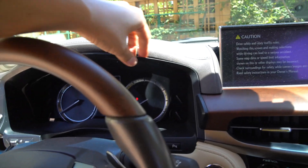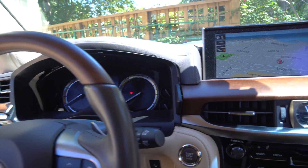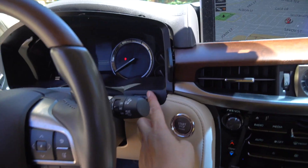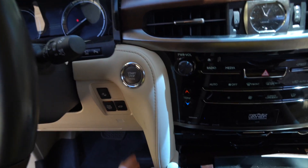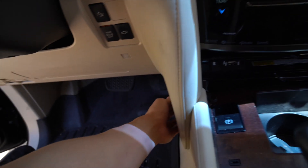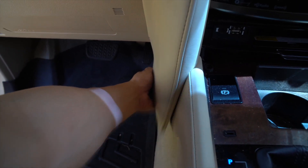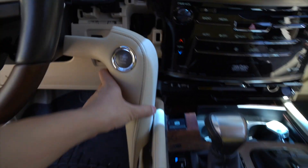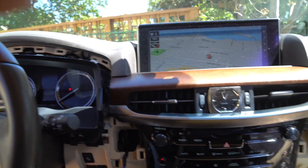I'm going to go ahead and finish pulling this area out. Once you have all that loosened, you'll notice that it's being caught right here, so we're going to remove this garnish piece on the left of the radio — it's only being held by clips. I'm going to stick my hand down there and just pull it towards me. Like that. Now this cluster area can get loose.